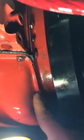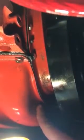And don't tighten it tight. You're going to want to do it slowly to get it in there and make sure everything is touching, you know, consistent, and not pressure and squeezing things out, and then it gets all messed up and it won't seal right. Lastly, the big deal is, like I said, when you replace the crankcase, the timing chain case, you have this damn thing here. You have to drop this oil pan to be able to seat it properly.